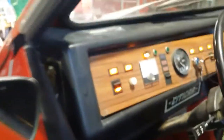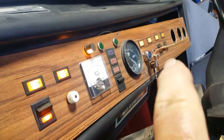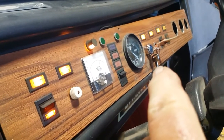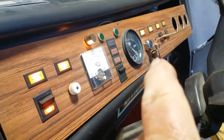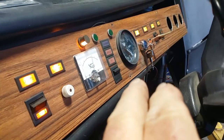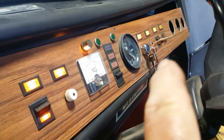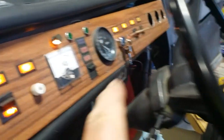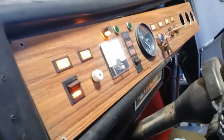I've got some stuff to show you. I have the dash pulled. I've already put the ignition switch in — it didn't come with an ignition switch at all. If you're working on something similar, you may not have a key. I ordered one on Amazon. It's a very simple ignition switch with no accessory position. It does have a start position, but obviously you don't need it in an electric car. It fit pretty well — I had to enlarge the hole slightly with a unibit.